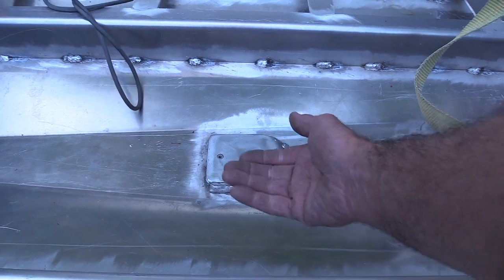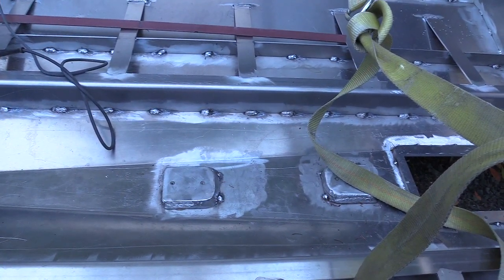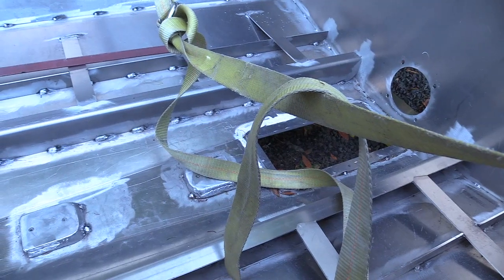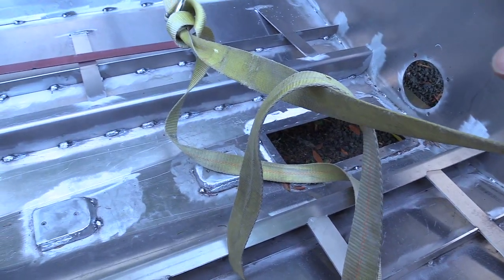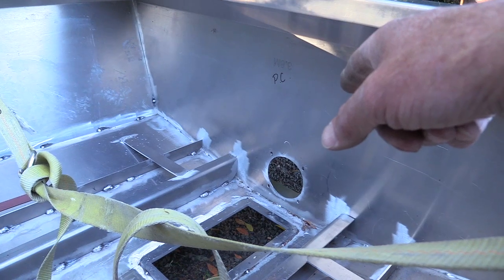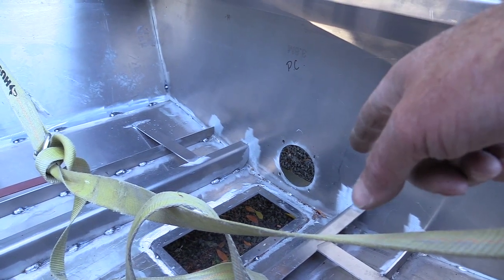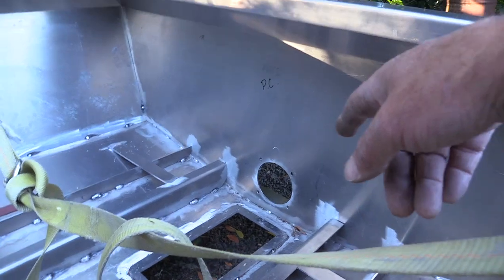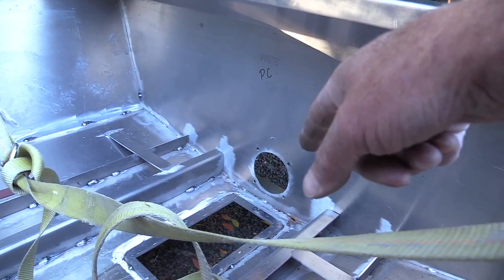To do that well — and not be mounted to the bottom of the keel in case of denting, moving the motor, and throwing off alignment with the coupler — I basically have to build something that comes down through underneath, with that mount raised off of the floor. Get it off the floor, get some gap, and raise that intake ring so you're not lodging rocks in there. Doing all that means I have to raise the hole, which means replacing metal.